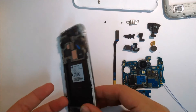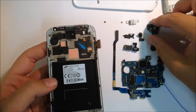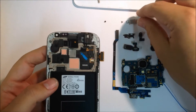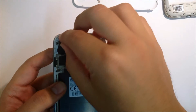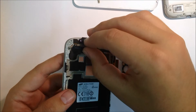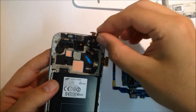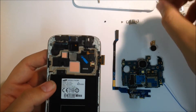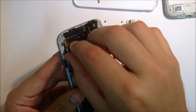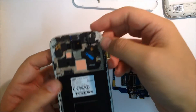Okay, let's put the phone back together. You can go in a relatively similar order putting it back together — just make sure you place everything back in its appropriate spots. That would be your front camera and your headphones done, and that's your ear speaker along with your sensor flex. This is your little gasket or metal clip that holds them in place, pushing them up against the front glass. Your vibration motor should have enough adhesive still left on it to go back in — you should not need any more, as the motherboard will hold it in place anyway.